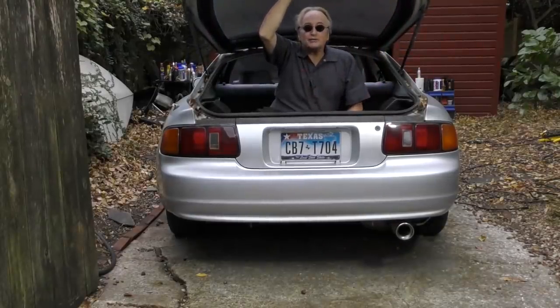And here's some bonus questions and answers. Freddy's a fool 25 says, got a 2001 Ford Taurus. I don't have any power brake assist. It's just like a rock and I got to push super hard to make it stop. When you don't have any power assist, generally there's one or two things wrong. Either the brake booster itself has gone bad, or it's not getting vacuum. 2001, so it's a 19-year-old car.